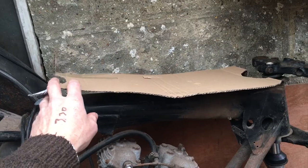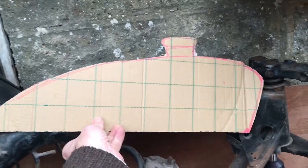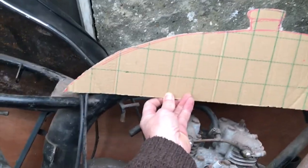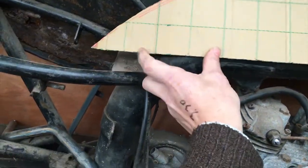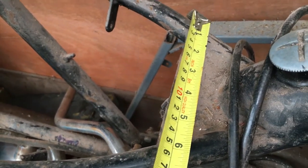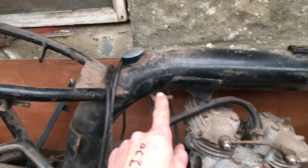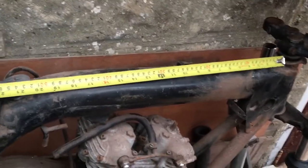...the Norton tank would be resting about here. I did this from Photoshop, estimating the rough dimensions of it, and I think it would sit on top here. That would mean that if you have a fuel tap right on the back end - depends on how far away it is - but the width here where the tank is probably going to sit, I think you've got about 6 inches or 15 centimeters. So it might be best to have the fuel tap further forward. I've seen another Norton tank where it's slightly further forward and that might be the best option. I think we've got lots of space to play with.